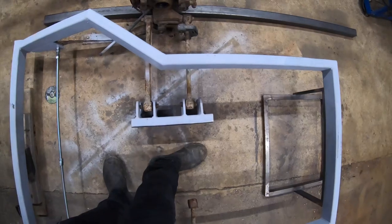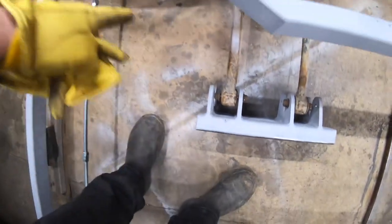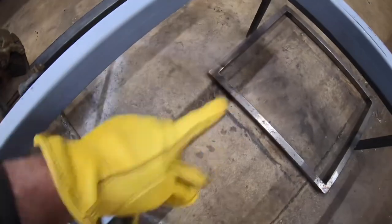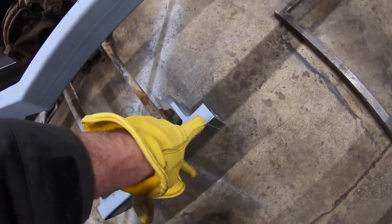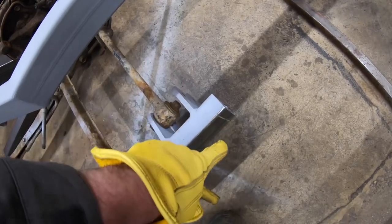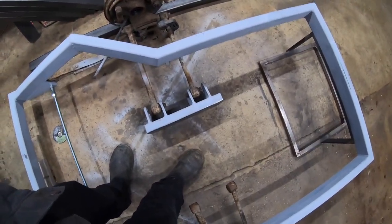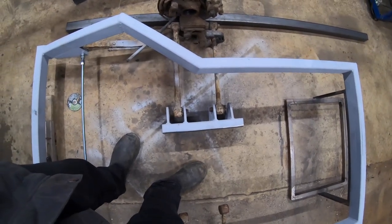It all takes imagination and a lot of measuring. How it's going to work is we're going to locate this bracket that we built in the last video, then basically take a tube and connect it in here. I'm not sure if I want to go straight up yet — meeting in the middle probably makes the most sense. In the back I think I'm going straight up on an angle. Currently this is a 20-degree pitch to meet the top tube section. I'm going to fix some of this and put it on a 10-degree angle, meeting up on a 10-degree angle on our new steel.